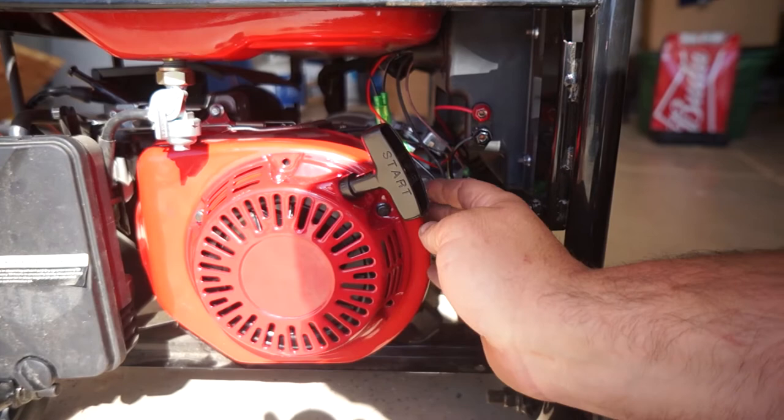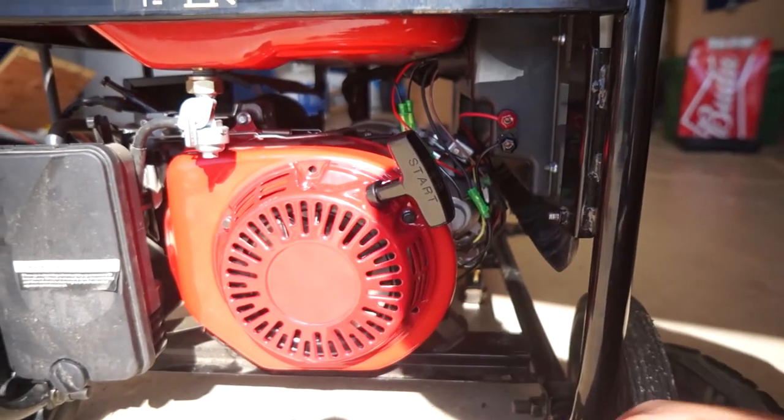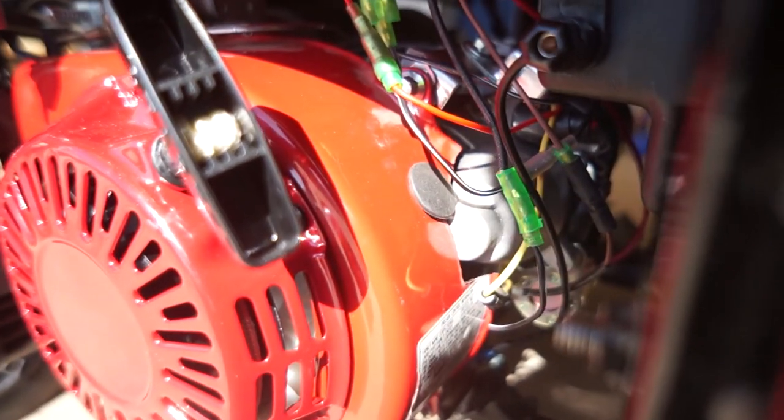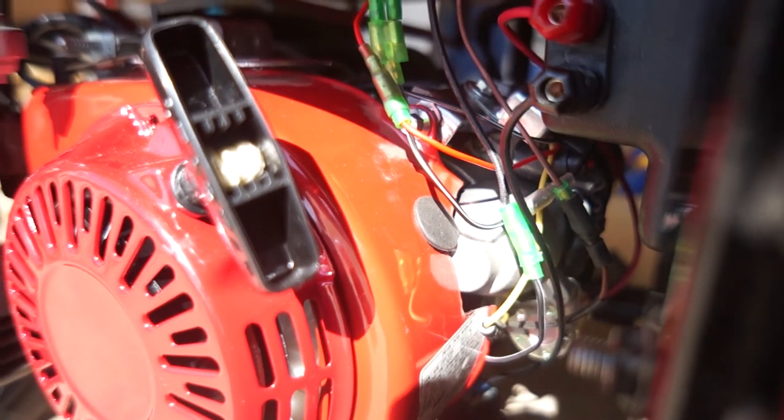I need to finish cleaning up the wires but I want to make sure I got this done before I start cleaning up. You don't necessarily need the pull starter to come with the kit. The starter right here — the hole actually had to be notched for it, otherwise the starter was not going to clear. Just took a little die grinder and cut the hole in there.